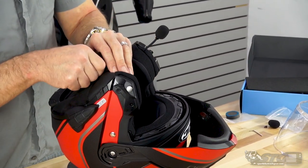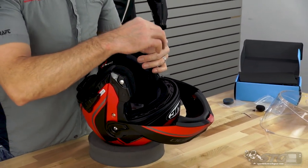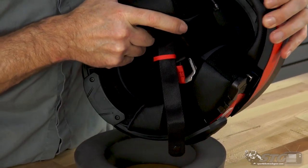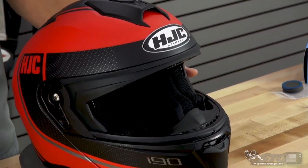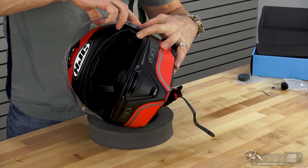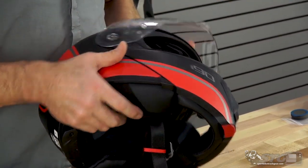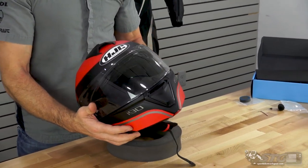This install is a little more difficult than the two full face helmets — just a little bit different. Now that you have everything in position, before you close the canopy, shape the mic a little bit — bend it up and then in toward your face. Grab the canopy and make sure you're clearing it. Lock the canopy in the downward position. Grab the shield, get it in the upward-most position, rotate it around and put a little inward pressure — you'll feel it dip right in. There's a tab that corresponds with the trigger. Actuate the shield a couple of times to make sure it's dialed in so it doesn't pop off while riding. Double-check the drop-down visor — that looks like it's working good.